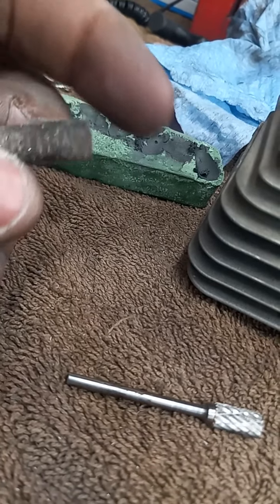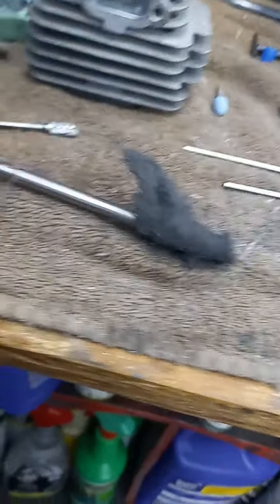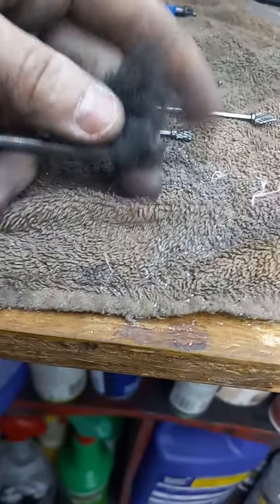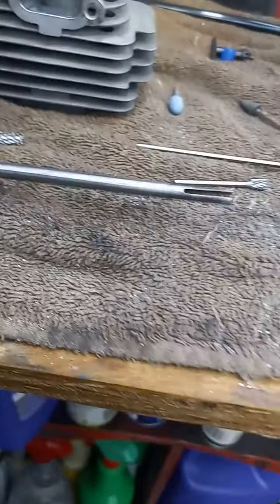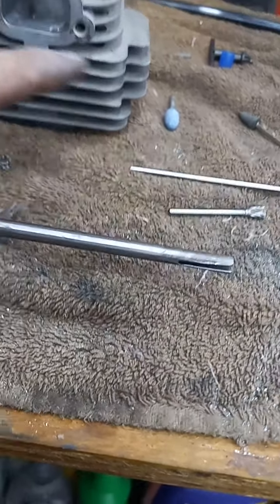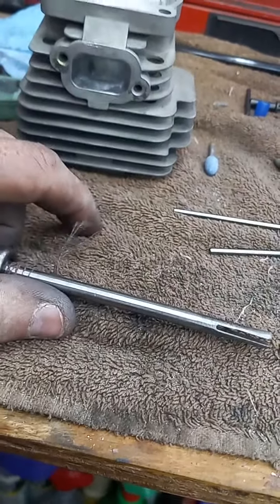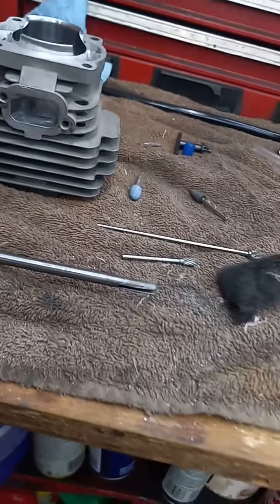I switch to sandpaper rolls and use a quarter-inch air grinder. This was a long quarter-inch carbide that I put a notch in — I can slide emery cloth in here in different grits. I currently only have 60 grit, so it takes a little more elbow grease to get them looking good, but I use the emery cloth twirling around on this to smooth out all the carbide marks, then a finer tootsie roll to take it down further.